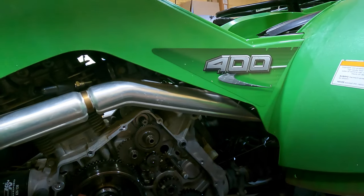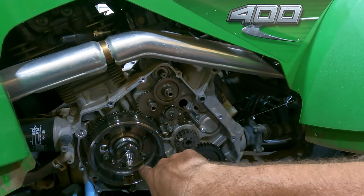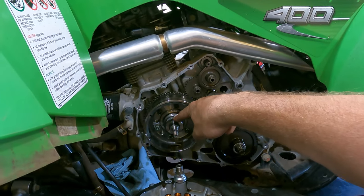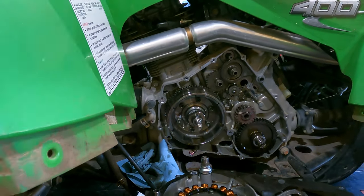So I'm gonna order up a rotor and I'll tell you the torque specs when it comes in, probably a few days. Like I said, it's gonna be a short video - I was just trying to get this quad in and out of the shop. But I was like, you know what, let me make one. I don't get an Arctic Cat in here very often with this issue, and I know a lot of guys battle intermittent spark or no spark. That's usually gonna be the flywheel on some of these. Always check your source coil, your pickup coil, your crank trigger, and then open it up and make sure the magnets didn't fall off. A lot of these also have a new updated flywheel where the magnets are captured between a metal piece on the inside - it won't be freewheeling like this.